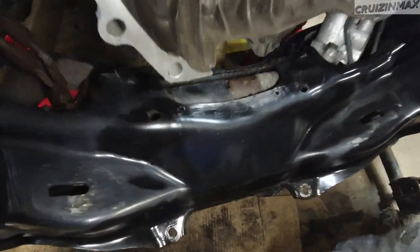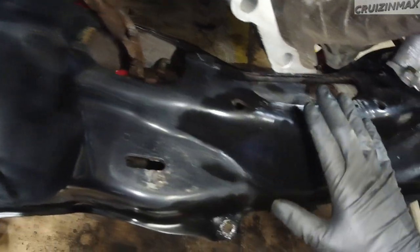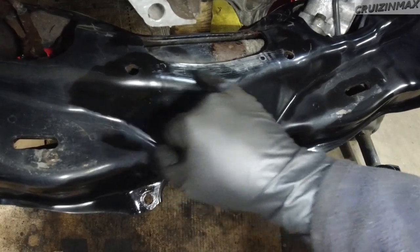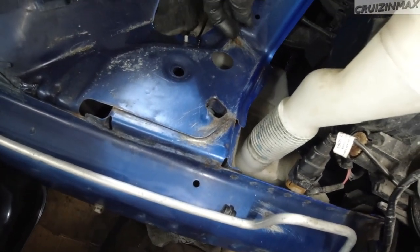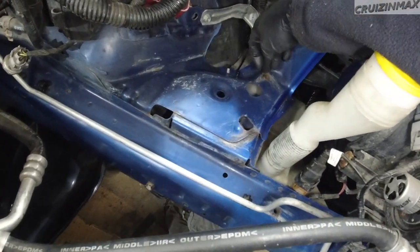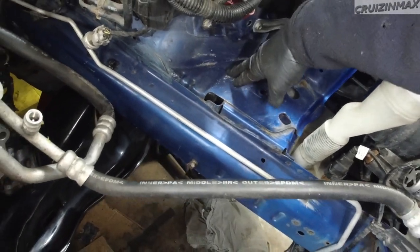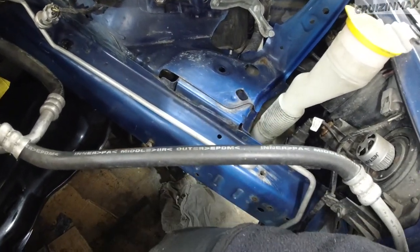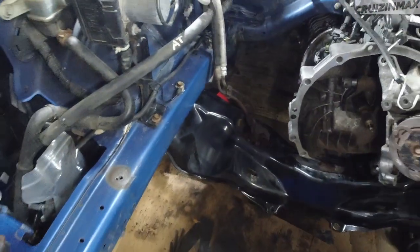Anyways, something I want to mention. Look for bubbles. When you're wiping it off, that's when you see all the details. So I had bubbles in this area here and bubbles in this area here. You want to sand these down because the brush will not remove the bubbling, rusting paint under the paint. So you want to sand that down, because if you paint over it, it's just gonna be several months before it pops open. Anyway, so this thing is ready to paint.